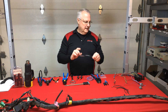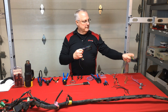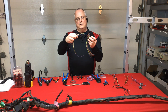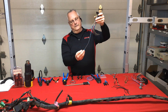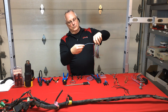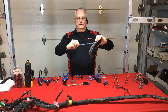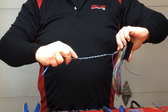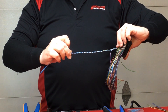What's the alternative? Let's go back to the six inch rule quickly — no repairs within six inches of a termination point. This is clearly not six inches, so what do we do? We provide the wire you need to extend your circuit. In this case, we provided a longer wire lead and spliced it further beyond the six inches required. I also want to demonstrate a twisted pair repair — I repaired it using a mini splice and was able to maintain the twist.